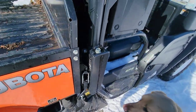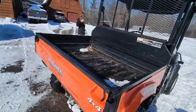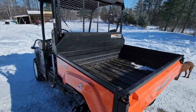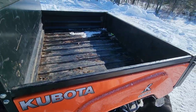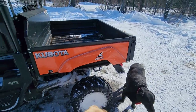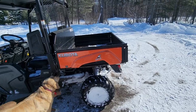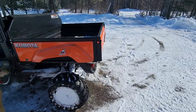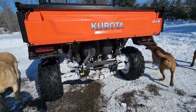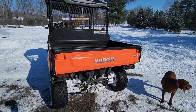We've had this for about two years. The only issue we've actually had on this entire machine is one of the coil packs went out, which was still under warranty, so we just took it in. And also on the exhaust, when that coil pack went out, it was causing excessive fuel to get into the exhaust, so I have a new tailpipe on there too. But that's the only issue we had, and it was covered under warranty, so no complaints there.